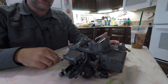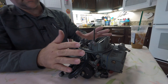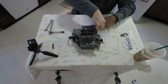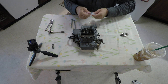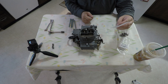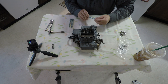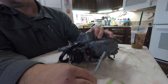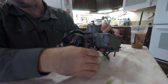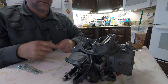So anyway, you've got four nuts that come off. And the first mistake I made was sticking it flat on a workbench. They actually tell you to get some bolts — I got four bolts. These are just 5/16 by 18 by 4 bolts. And what you're supposed to do is put a nut on it like so, and then it will set up like a leg, and then you stick another nut on top to tighten it down. It's kind of a kickstand to help prevent scratching the bottom of your carburetor.